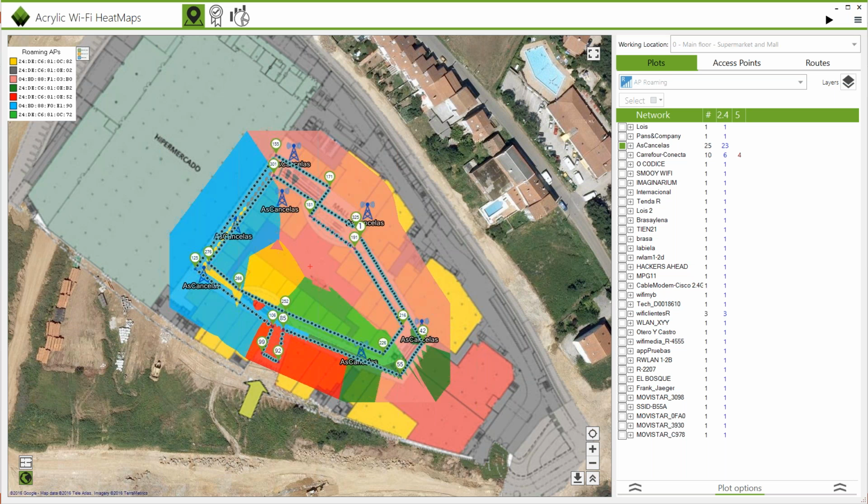Okay, someone is asking why we need an additional Wi-Fi card. That's only if you want to perform an active survey. The one in your laptop, for example, will be listening to everything, but you need another one to communicate with the server, so you can get real data about latency or bandwidth, for example.